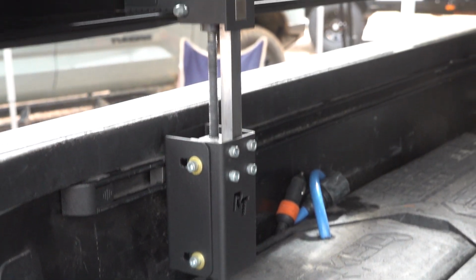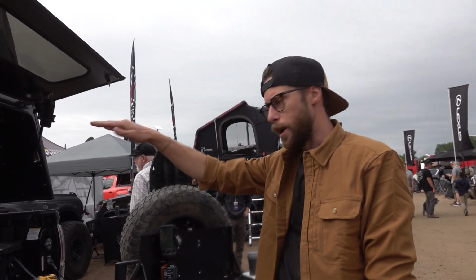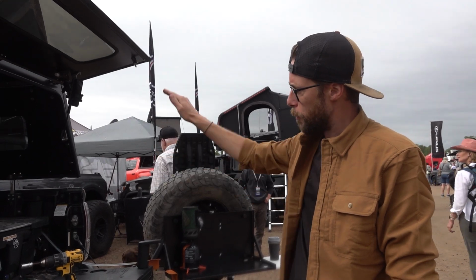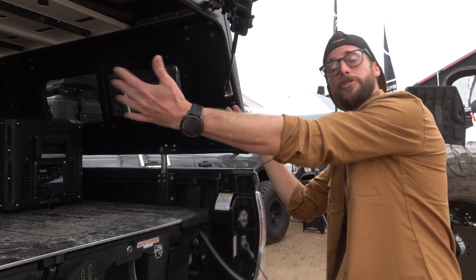The rapid lifts themselves are basically straight bolt-on. You're only drilling 4 holes on the flat lip camper, specifically for this turbo topper. Adjustable for up and down and front to back. You've got a guide bar that actually keeps the camper true and straight.